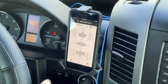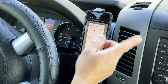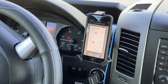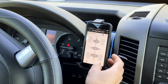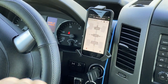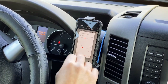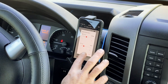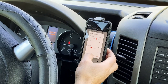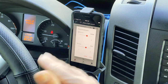There are three G-threshold settings. First is forward acceleration — floor the van getting on the freeway hard — you set at what point you want the shocks to firm up. Second is side-to-side acceleration, which is the head-toss that Sprinters have to fight all the time; this system works great at controlling that. The third is negative, meaning deceleration — coming up to a stop sign, getting off the freeway, heavy braking — the shocks will transition to firm once it crosses the G-threshold you set. Time-on is how long the shocks stay in firm, and force is the G-rating threshold at which the shocks will firm up.